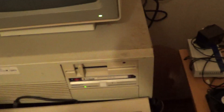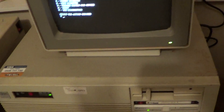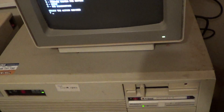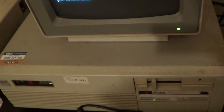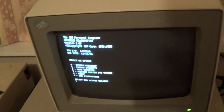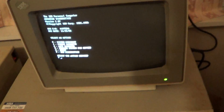Cards I've got in here: I do have a Sound Blaster Pro, a 1MB VGA card which is silly overkill, the EverEx 3080 RAM Deluxe, and the SCSI card from Adaptec. The hard drive and floppy are provided by a Western Digital proper 16-bit card, so I've got a nice high IRQ. I've also got a twin serial port adapter in there, but no parallel because I ran out of working IO cards — I have boxes of them but couldn't find one with parallel that didn't have a shorted capacitor or didn't work.